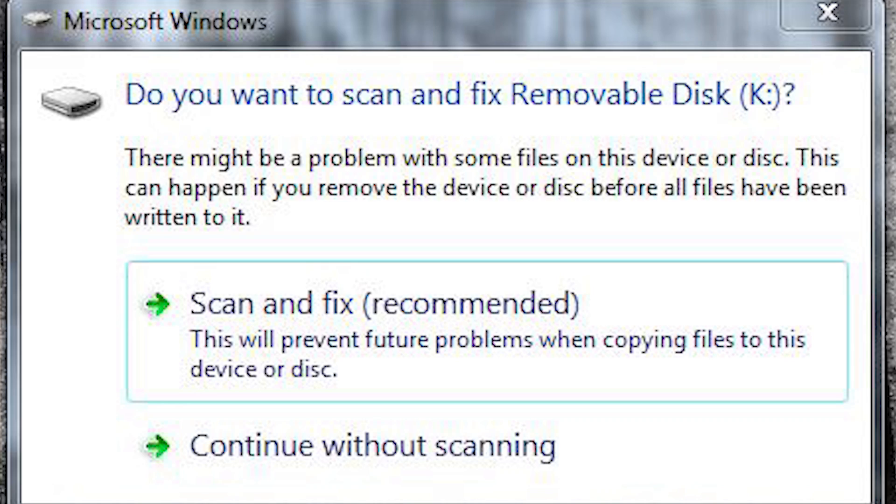My main complaint is it does take a while to start up. If you're trying to get printing quickly, the tablet does need to boot, which can take a bit of time. And for some reason, this USB stick always corrupts itself when I put it back in the computer — probably because when I pull the power, the tablet just shuts down. Nothing gets lost, but it does say there are errors on the USB.